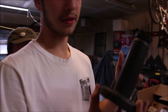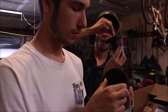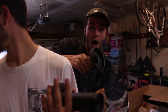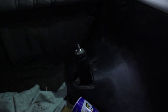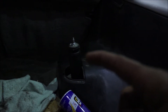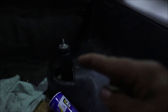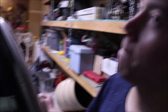We got the studs out of the old top hat and put them in here — Danny helped me press these in. We also got the rubber piece — it's where your spring goes in, pretty much. Now we have to do the other two. We also painted these with some barbecue paint. So this is about what it's going to look like in the back for us. As you can tell, that's a lot higher — it sticks out a lot more than the three and a quarter inch did. That gave us enough preload to stiffen up the back, and now we're good to go. We're just going to throw on the wheels, see where it sits, give it a couple bounce tests, and call it a night.